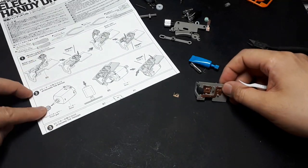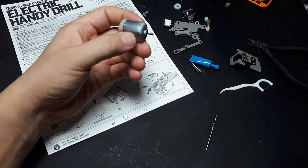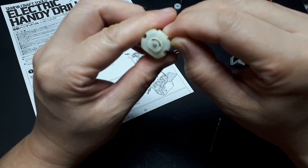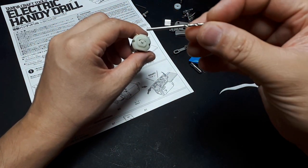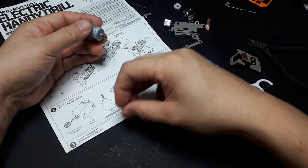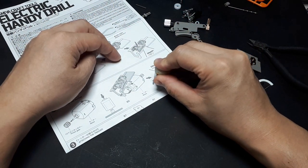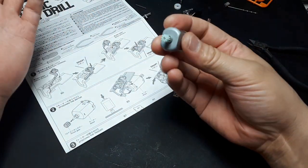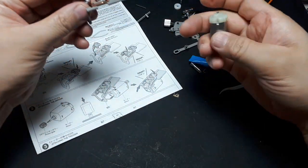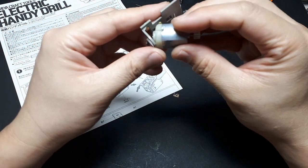Okay. So attaching the motor. Make sure you don't have the staples randomly attached to that. You'll see it's got two contacts. I want to bend those up slightly. Hey, you know what? There is a drill bit here. Alright, so the pinion gear is made of plastic, and it's recommending in the instructions to put the pinion on the table, push the motor right onto that gear until it bottoms out, and that worked pretty easily. Alright, so now holding this in the down position and holding the contacts in the up position, this is supposed to hook into this thing.